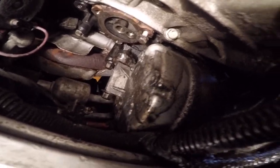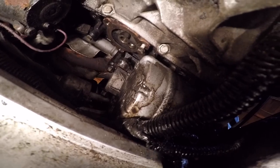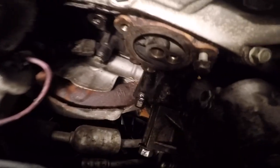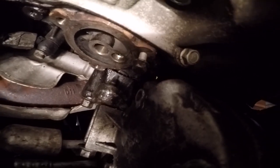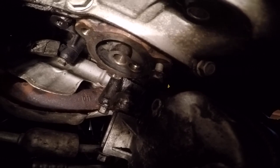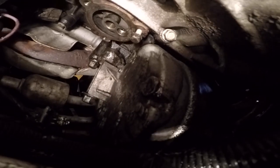Some people say you don't have to take all these bolts out on the compressor to get the oil filter housing out. Up here, this bolt that's sticking out — you just need to be able to slide the housing out of it. But I couldn't even loosen the bolt because my socket wouldn't fit, because of how close the compressor is.